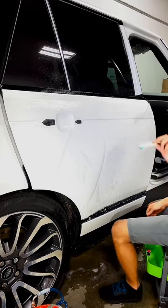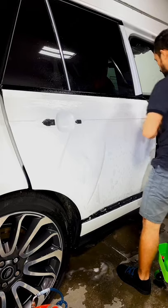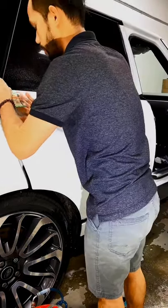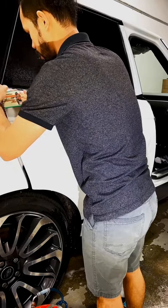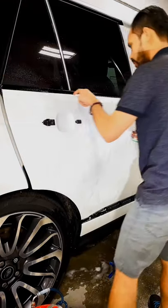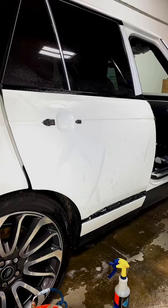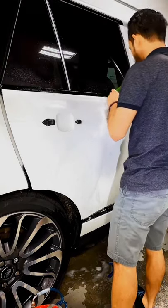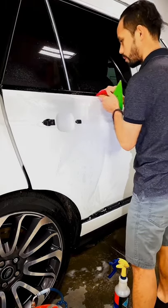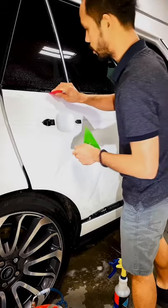So right now I'm using the PPF sandwich. Okay. Lock that corner down and go to the other corner. Just a little mist, not that much. Make sure you go underneath this trim. Make sure no gloss is exposed. Just go underneath. And the best tool to do that is this pink. If you have the pink contour, this is the best tool. So shove that underneath. Pink squeegee is the best squeegee too. Do that. Boom. So now our top area is sealed.